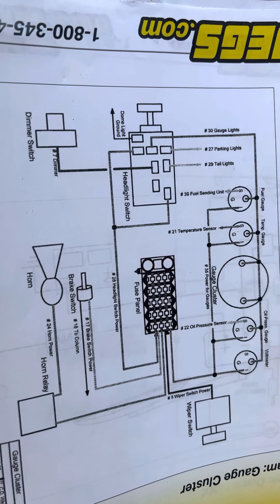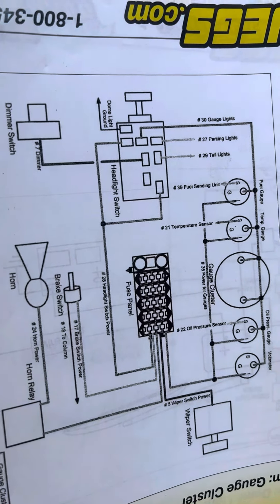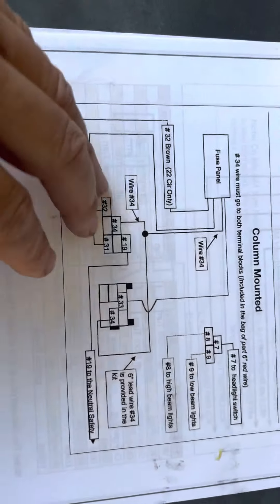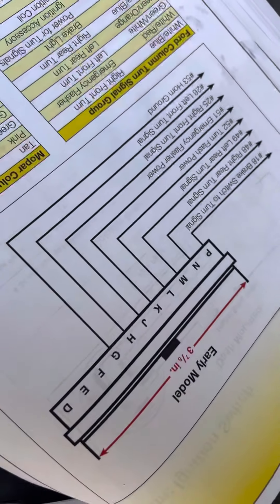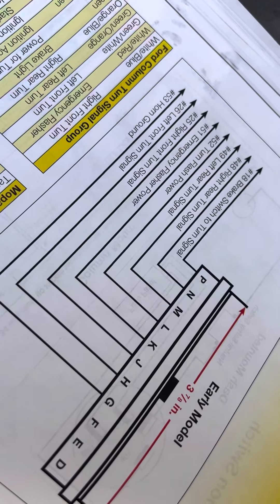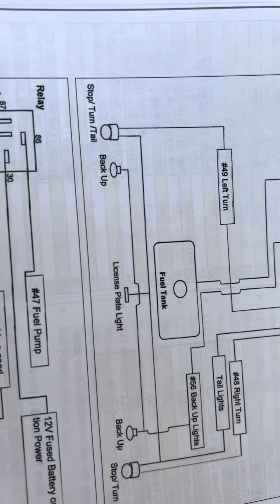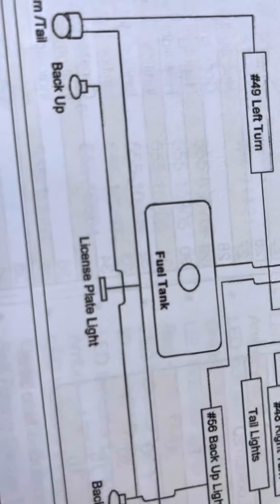I'm going to try to keep the gauge wiring together and just put a hot wire to the existing ones because they're not beat up by heat and oils — they're in pretty good shape. Some of these are dash mounted like mine because it's a 68. Then there's the regular GM ignition plug which just plugs right in and you're in business. There's also a headlight switch, your column plug for flat GM style, and the tail light group and fuel pump relay.